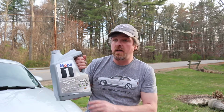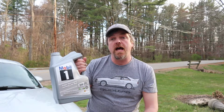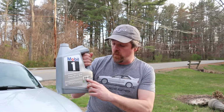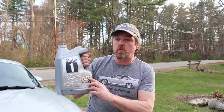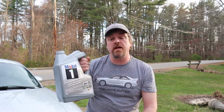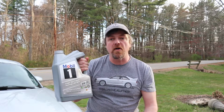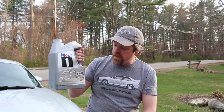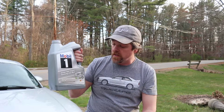Inside of those three types of oil, there are different viscosities. The different viscosities that are listed on the bottle are the difference in how they resist moving fluidly. The 5W means 5 winter, or the cold weather, and then the 20 would be on the hotter side of the engine, and they change due to the temperature of the engine, which is what they call multi-viscosity. We typically use the full synthetic because, as I said, it lasts the longest.